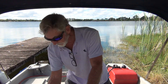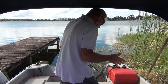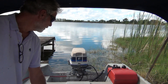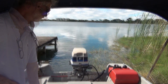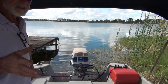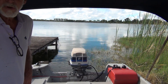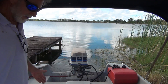This is going to be your first start with those plugs that I re-gapped to 28 instead of 30. Let's see what happens, see if it's still hard to start. I hate this key switch. But I do know that on that run it didn't seem the same to me. There was a slight difference. So the next set I'm going to go 32. See what happens. Put them in and do the indexing, make it for a run, and then see if there's a difference.